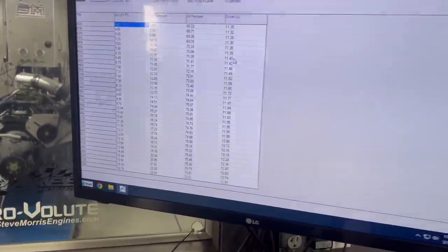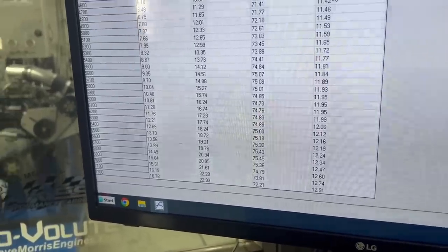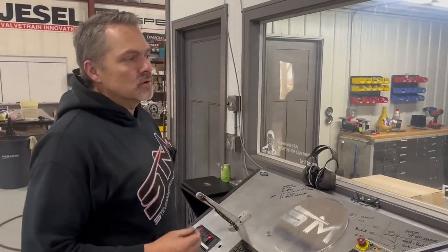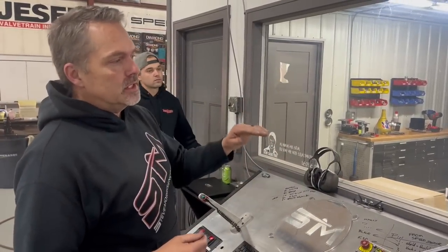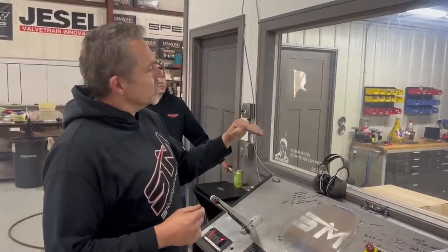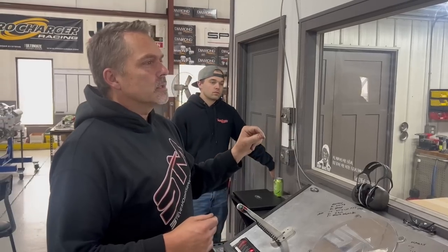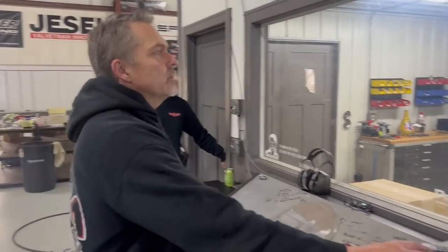7,500-ish. So we're going to try getting there. The horsepower is about right. It's making about 50 horsepower more than I normally like to do, but it is on that whole edge. So if we can fix it with the jetting, then obviously the needle and seat is okay. We'll probably raise the fuel pressure, maybe 1 pound. Let's see where it's at right now.